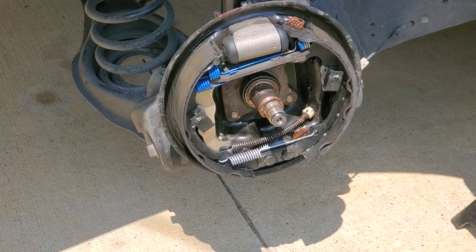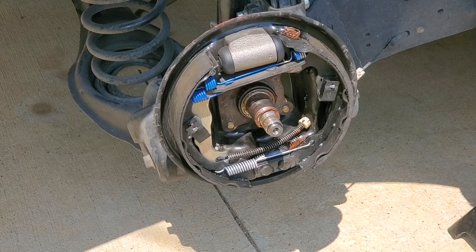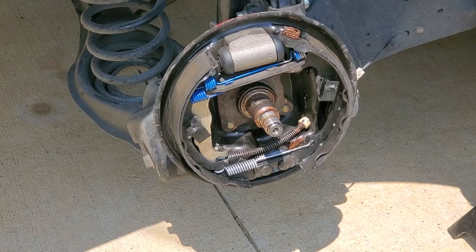I made a little discovery. I think I didn't grease the brake shoes well enough, so when I compress the brake pedal, it's catching on the drum itself and that's causing the knocking sound. So I'm going to take off all the braking hardware, put on brand new braking hardware, and lubricate the back plate contact points where the shoes touch. Then we'll put everything back on, test it, and see if that fixes the problem.